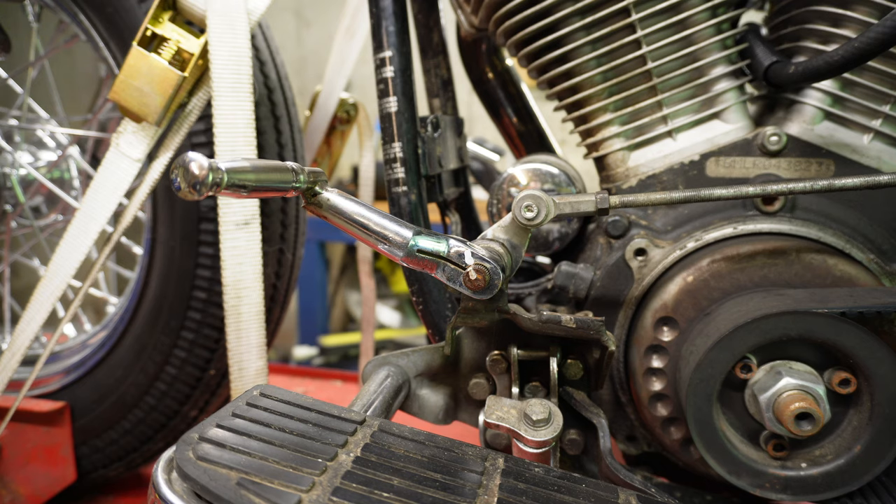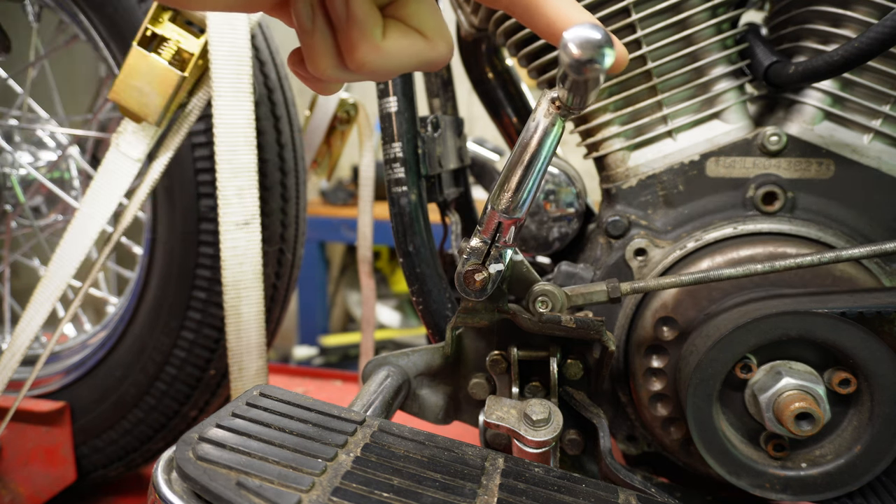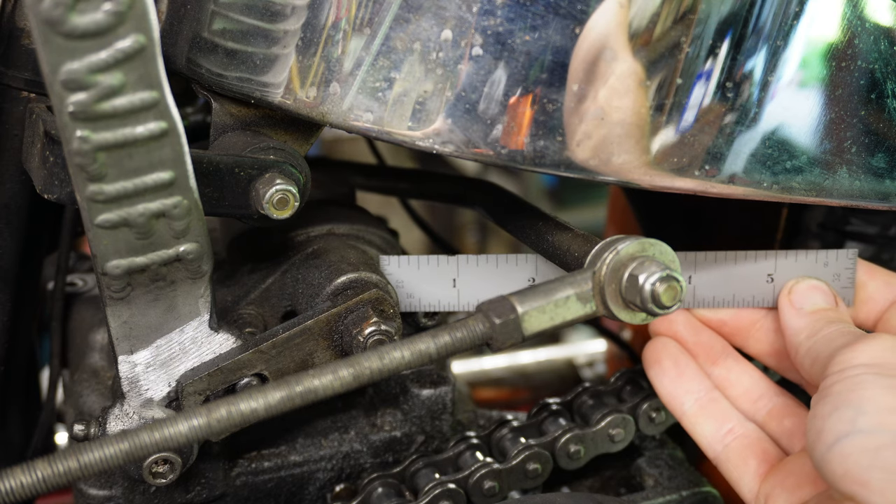One thing you might have noticed on my particular setup is that my foot pedal is on a splined shaft. I'm sharing this as an example of why this thing has to be set by feel — I could put that adjuster screw way out of factory spec, then just tilt my clutch pedal on the splined shaft and put it back on. Or I could bring it to where the full stroke pulls right up tight against the back of the transmission, change my pedal, and still be in the perfect spot. There isn't one spot that works and all others don't. Don't worry if somebody tells you that's not where it's supposed to be set — there is no 'supposed to' once you get into custom parts. That's what this video is all about.